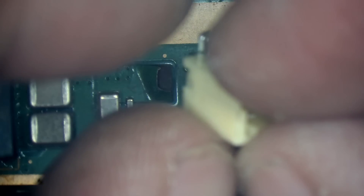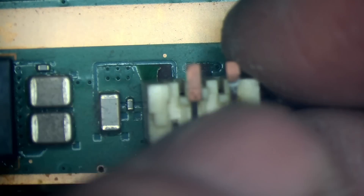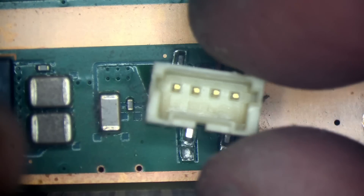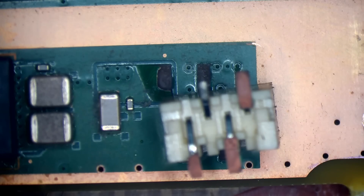Under the microscope we go. We can reuse the connector because it hasn't been damaged — no one's tried to glue it or anything. The problem with these, like I say, is there's no anchor points. On the newer PS4s there's an anchor point on the sides, but on these ones there isn't, so when people go to disconnect it they pull up and end up damaging the connector. I'm going to prep the connector first, ready for going back on the board. The only problem is you have to find a way to secure them — you can use super glue or similar.